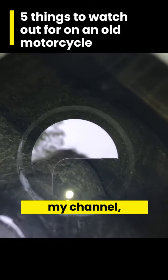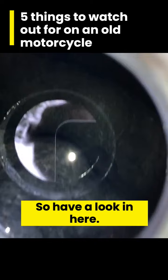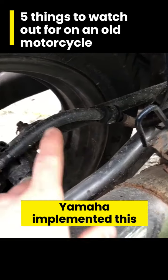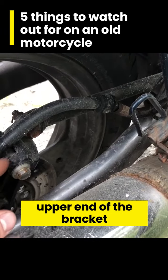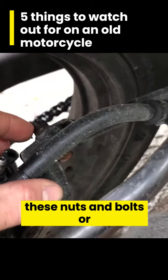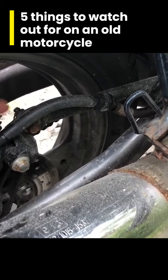If you've been following my channel, you know I had to cut this open and seal it with POR-15. So have a look in here, look for any suspicious looking rust, because that can be a nightmare of a job. Yamaha implemented this arm here to hold the upper end of the bracket for the rear brake. Make sure all the cotter pins are in place for these nuts and bolts, or else you wouldn't want one of those to rattle loose and have this arm come flying off, so check for the cotter pins.